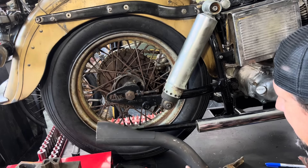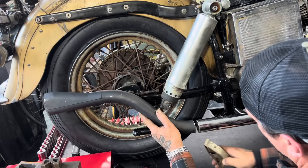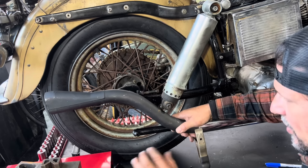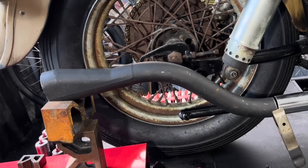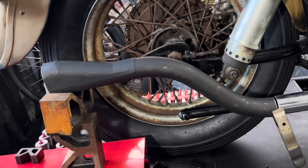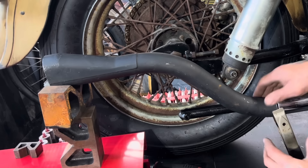Check out how I set this up for welding. I grind a little V in each end of the pipe to get a good TIG weld. I'm going to hold these two together with a little metal clamp, but to keep it at the angle I want, I'm using this motorcycle jack with a couple of V-blocks. I put the V-blocks flat instead of V-side up, and all I do is jack up the jack to get the angle I want. It'll hold it in place so I can have both hands free to TIG weld, because you need both hands to do a good TIG weld.